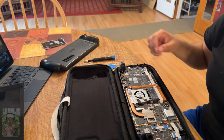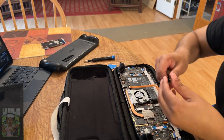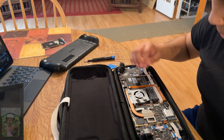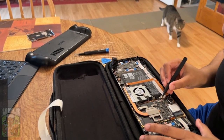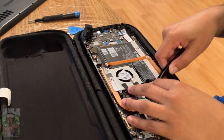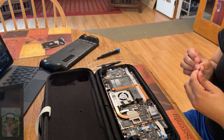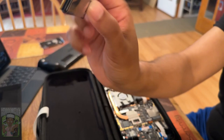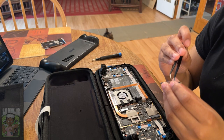Here I am trying to get the battery loose — be very careful when doing this as well. You don't want to snatch it or just pull it; use some tweezers, get a good grip, and pull it out that way. You can see me looking at a YouTube video to see how someone else did it, and then you will see me pull the actual strip to detach the battery. That one screw is like no other — unscrew it, pop that SSD out, and you know what to do from there. Once you pop the SSD out, be very careful with that lining shielding — use tweezers to carefully pull it apart because you're going to want to put the shielding back on your brand new SSD.